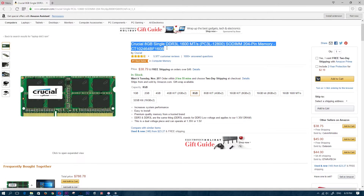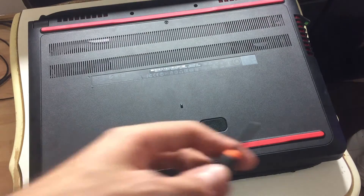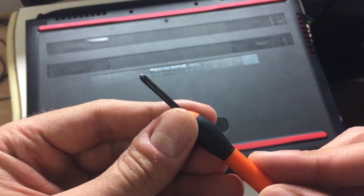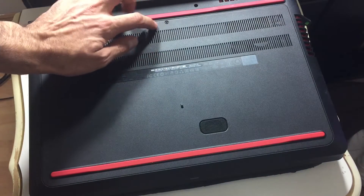Go ahead, buy it, and now I'm going to be showing you how to place the RAM in the slot of your laptop, particularly with the Inspiron 7559. For this particular laptop you're going to need a small Phillips head screwdriver, and you're going to need to locate the one screw that you have there on the top.